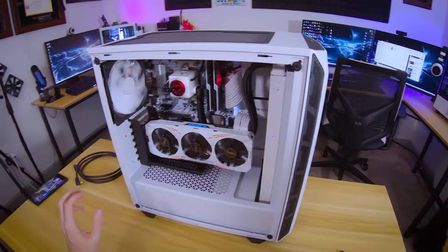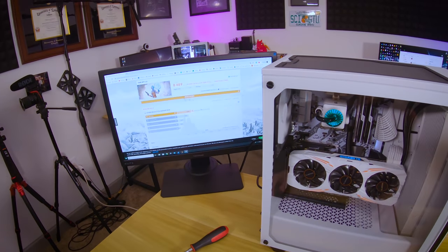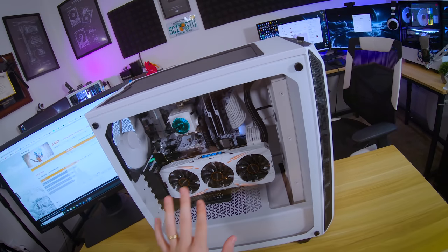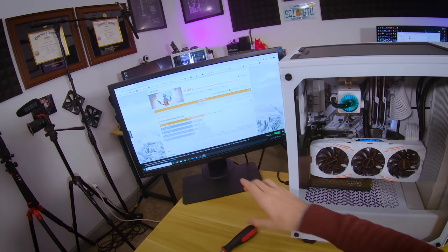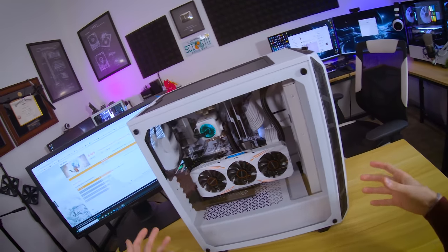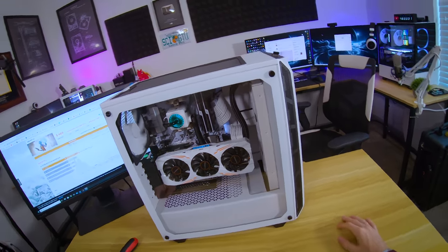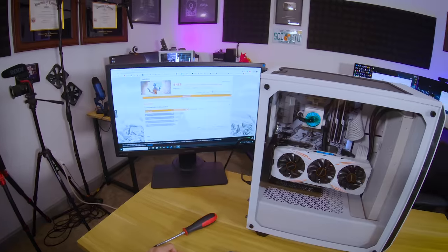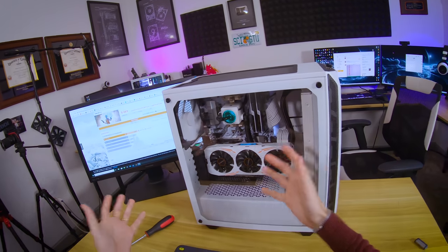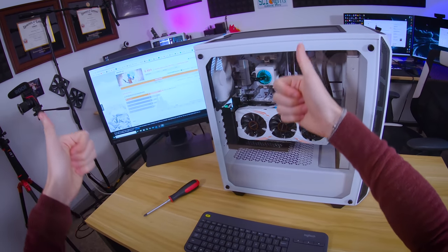The pump just finished priming and it's now very quiet. We'll fix the fan curves and install Windows 10. There we go — 3DMark Time Spy score of roughly 8,500 with a Ryzen 5 2600 and a GTX 1080 Ti, both running at stock with 16 gigs of 3200 MHz 16-18-18 timings. That's better than 75% of all results, which is pretty good. This build is about $1,000 or so. Thank you guys for watching — hope you enjoyed the POV style. Let me know in the comments what you think. This is Science Studio, thanks for learning with us.